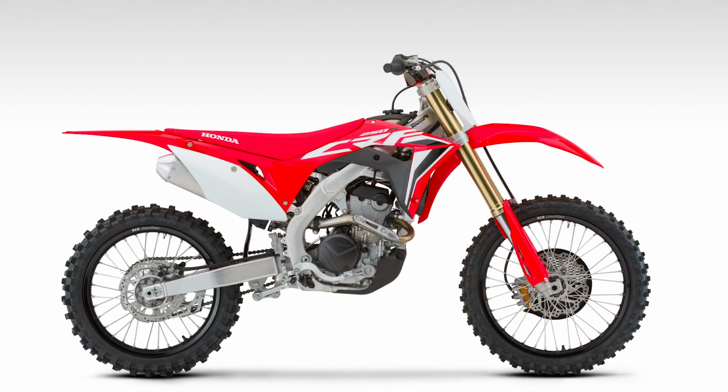We'll have to learn more when we actually get to the intro and get to talk to the engineers about exactly what areas they changed, because for the 450, they basically changed the back half of the frame. The weld you see on the center of the spar going down the side spars, from that point down to the foot peg area where it meets with the cradle, swing arm, shock tower, that whole area is what changed on the 450 frame dramatically. The 250 though, it's claiming a new frame, may just be that update area, but it doesn't specify an area, so it might be its own frame in the end.